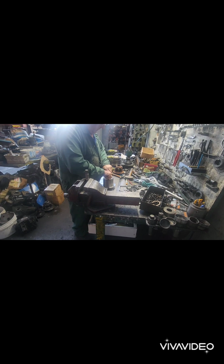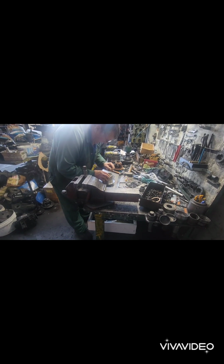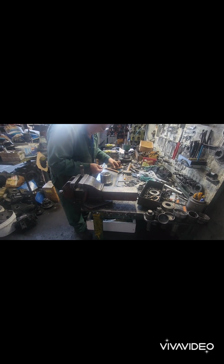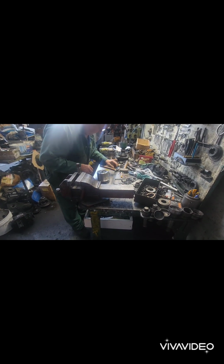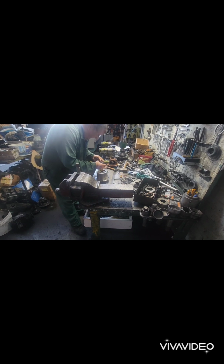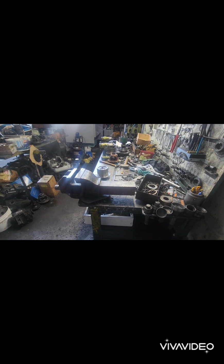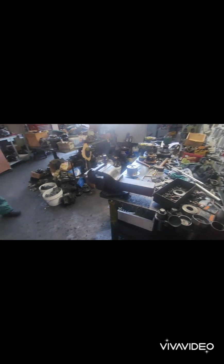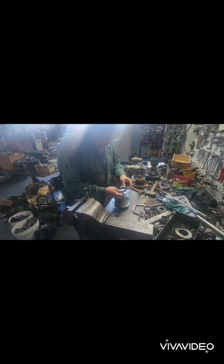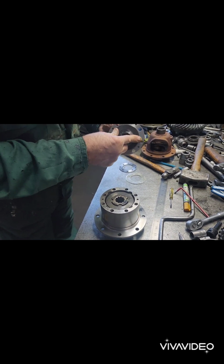Only a little tiny short spigot, this. So you gotta, it's easier. So what we got here, so there's 2 10s and a 5. We'll leave that out and utilise these to change all these plates around. So we've got that one. Now we're going to put in these parts here, see? So I cut those off because they're going to fit up inside this counterbore, see? It's been counterbored, that face.